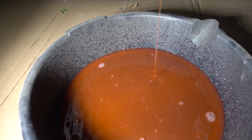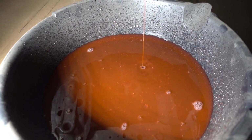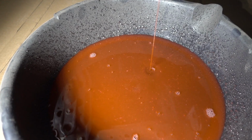Need a little coolant flush as well. I think it's a good idea because it looks a little orangish and it should be pink. Well, on the camera it looks a little orangish for you guys, but it's not as clear as it should be. So while it's almost finished draining, there's still a couple drops dripping here and there, I'm gonna start removing the water pump pulley, which is right there.